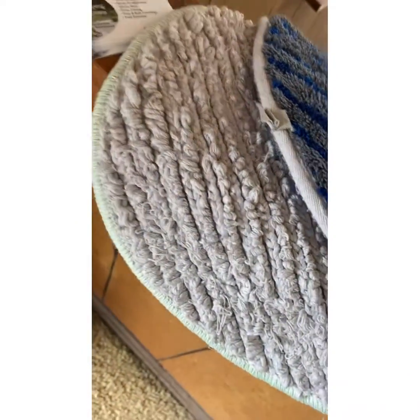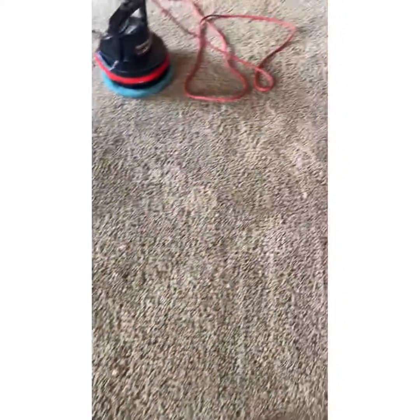What I'm going to do now is hit it with another shot of pre-spray, then go microfiber first and finish it off with the Iron Man. I have pictures of the earliest shots — the carpets are pretty much all over heavily soiled. When you're dealing with carpets like this at a car lot, it's nothing but pavement out there. A lot of the black soot and soil that gets into the carpet is actually asphalt, which is an oil-based product. So you want to use an oil-based cleaner to remove it — that's basically what it is, just oils causing the stains. That's just a little tip.